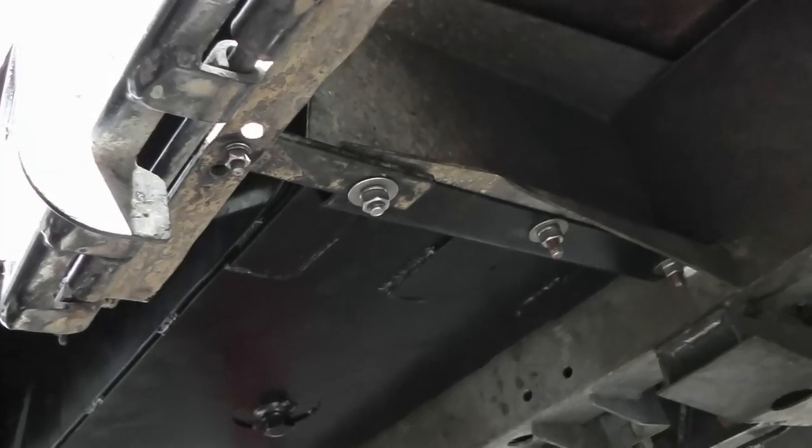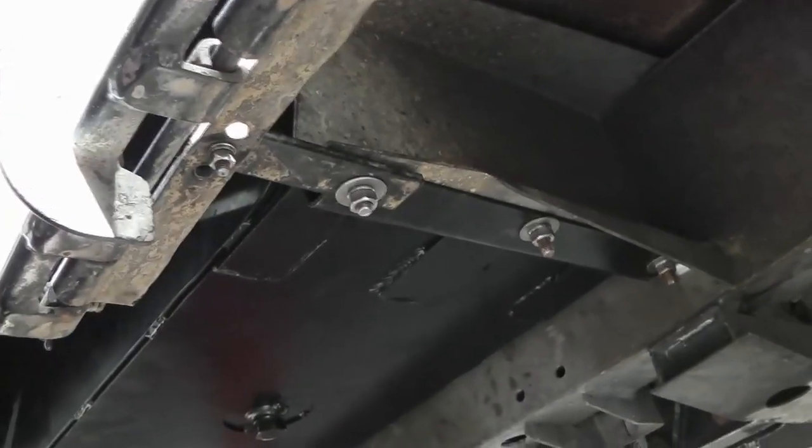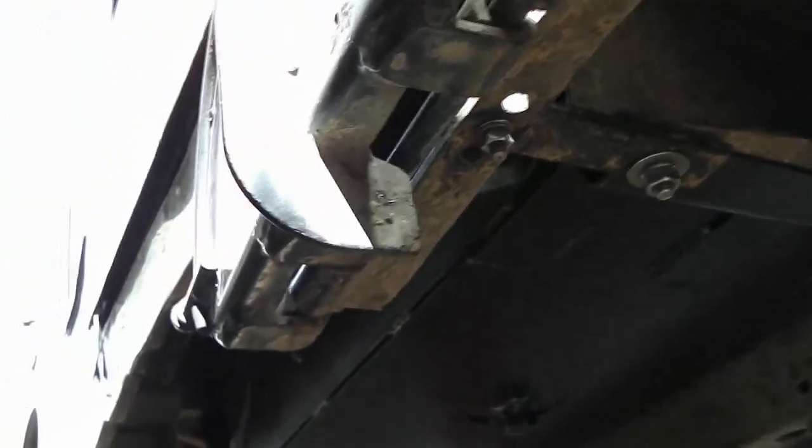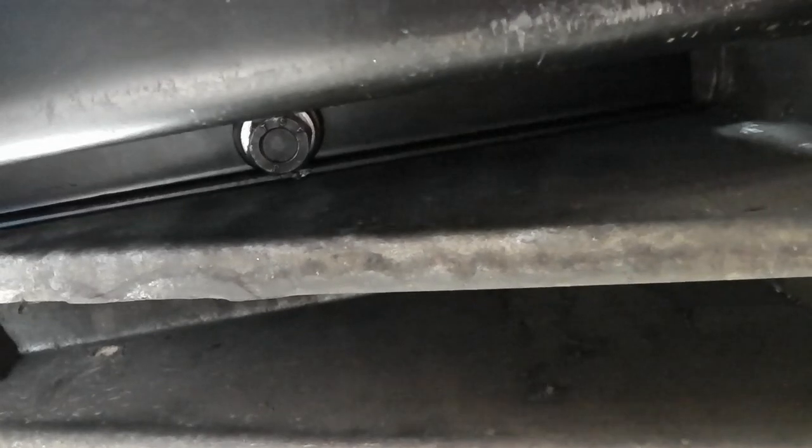So now I've got to look at putting the tap in which goes down there. Rather than using the fixings that came with the kit I've used some stainless M8 bolts - this might make removing the tank if ever that's necessary a little bit easier. I just drilled out the stay for the step. There's a nice bit of clearance around it actually, it has fitted quite well and it's not really rubbing anywhere. Up the back you've got a single bolt with rubber mounts - you tighten the nut as much as it will go and it bottoms out on the shank of the bolt just compressing the rubbers a bit. It's all rigid but it just allows the tank to flex, which is important as the chassis in these moves a bit.